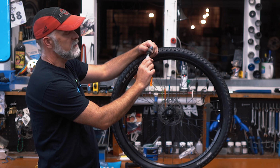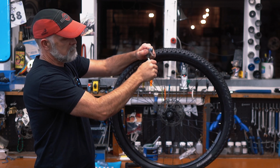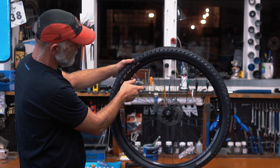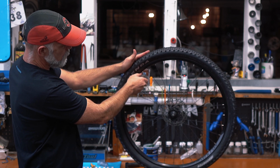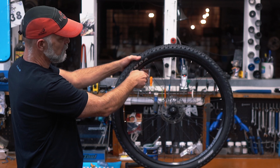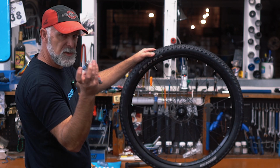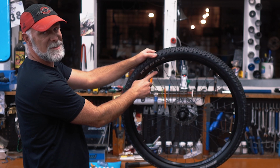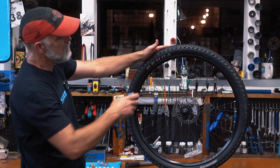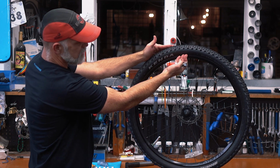When you puncture it, you will hear a little air release, and you can go ahead and do that. They all have valves of one sort or another. There we go. And if you want to test it, you can do that. There you go. Now I'm going to put it on here and release air. In this case, I'm going to release about a third to a half of it. Real quick, this is already really cold, and I'm going to pull this off. Like that. Be prepared when you pull the CO2 off. Sometimes that little nut will freeze open, so you need to be ready to close that if it's leaking air out. Okay, so I only did a third or a half to be able to look at the bead of the tire, make sure I've got everything seated correctly, and the bead isn't coming up off the rim.